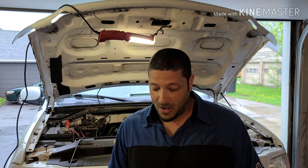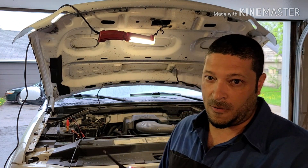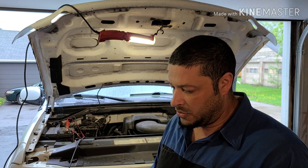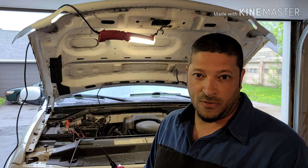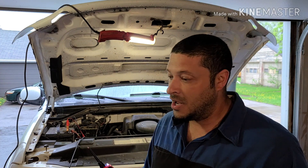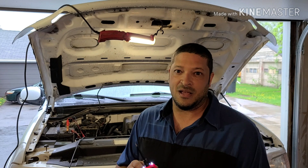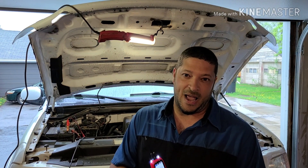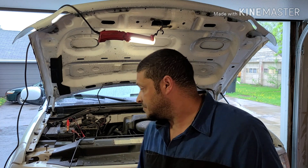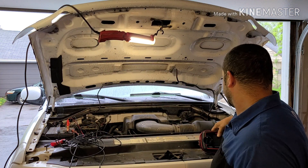Although this tool can read from 12 volts — or whatever your battery voltage is — down to zero volts, it hits the range but it's not always accurate. It's not going to be the be-all, end-all in accuracy. That's where the DVOM comes in handy.